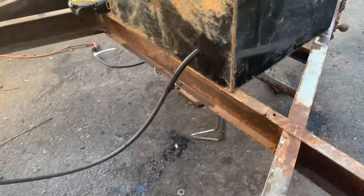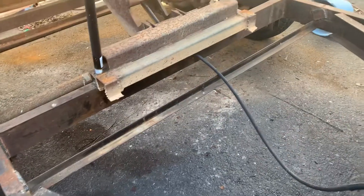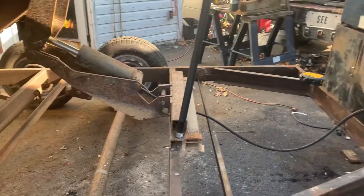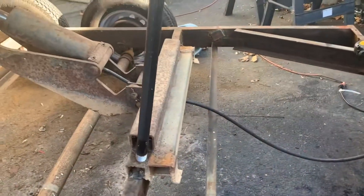My plan is to run some steel welded back from here into the front of the trailer. It should hit right where it triangulates, so it'll be nice and strong and help resist that warping — which could end up cracking that cross member out, even though it's very heavy steel. Still a lot of force when you've got a bunch of weight on the bed. That'll be one of the next projects, a separate video. Let's go ahead and see how this thing drops.